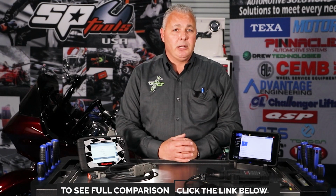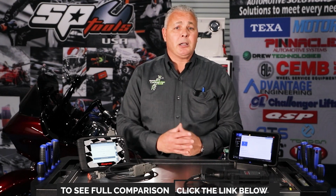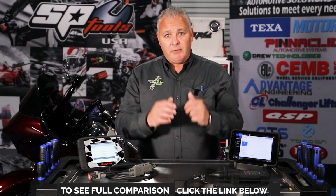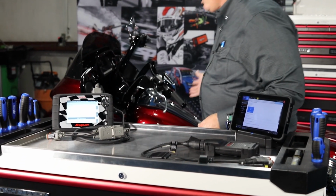When it's all said and done, to be completely honest, I was slightly disappointed in both tools. The P1000 performed well, although it had a lot of bugs and glitches in it. We had some tests that didn't work properly. We had some tests that were displayed under the fitted systems that didn't apply to this vehicle at all. We had bidirectional capabilities that were missing in the TEXA IDC5 software, as well as a few modules that were a little light or lean in the data offering. So as a technician and a former shop owner, I'd have to say that, to be honest with you, if I was working on this bike in my shop, I'd be slightly disappointed with both tools.